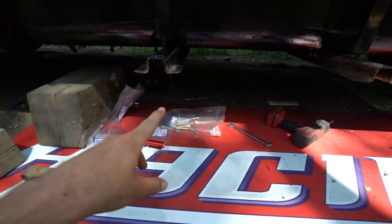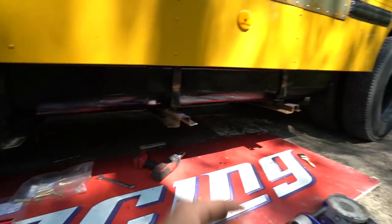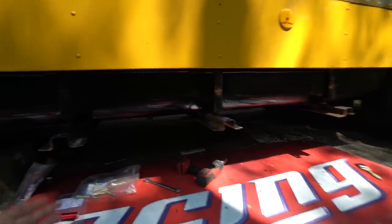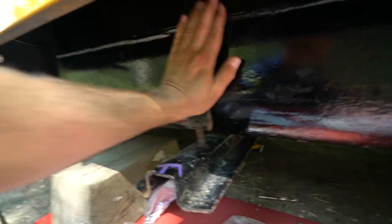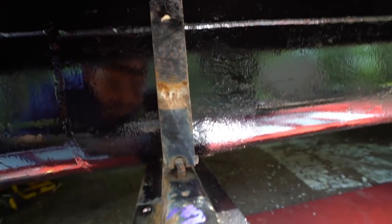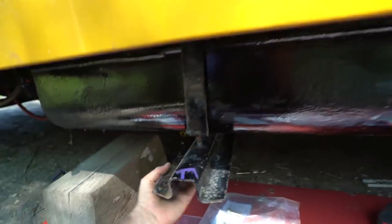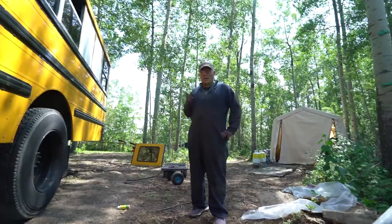Check it out — we have it. He left me a couple nuts and bolts to work on. This is more or less what it's going to look like. We still got to tighten down the straps and the bracket with rubber in between. Never forget the rubber when you're putting in brackets and straps into a semi-truck fuel tank. Don't forget when you're working on a bus — don't forget your rubber.